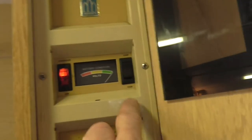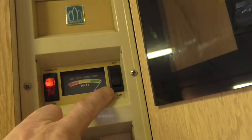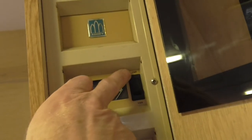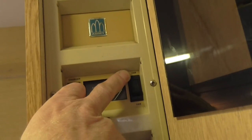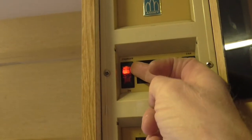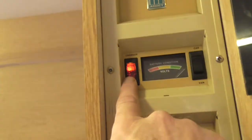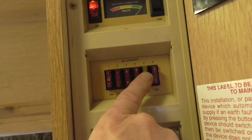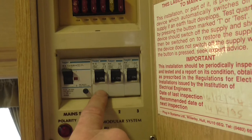Below here — this is if you had a leisure battery put on the van. You'd click to use the van on 12 volt and not 240 — you'd click this switch down onto 'van' and that'll give you 12 volt in the caravan. Or if you switch it to 'car' it'll either put the fridge onto 12 volt to chill it down, or if you don't have the fridge on, it'll also charge up the leisure battery. And this switch on this side is a 240 volt charger — when this is flicked on it'll charge the battery up and run power into the van. These are just ordinary car fuses for various things around the caravan like your rear lights and brake lights, and this box here is the main override box for all the electric circuits.